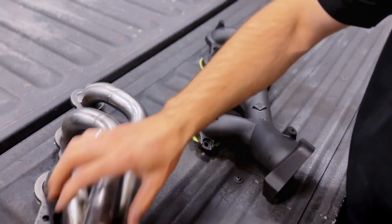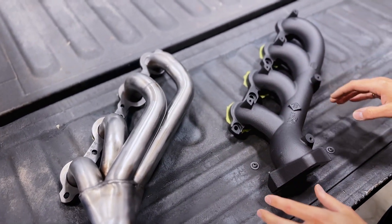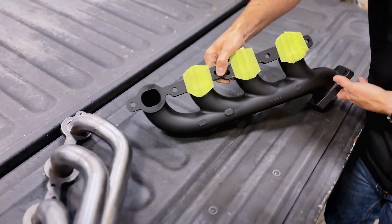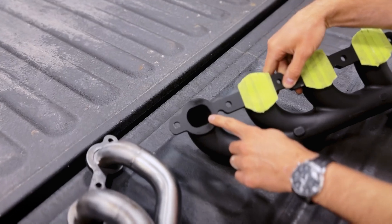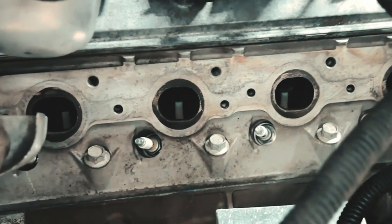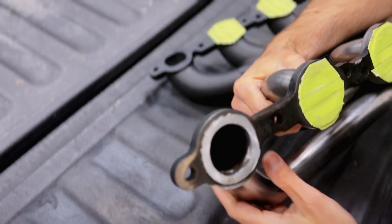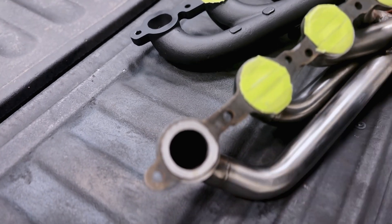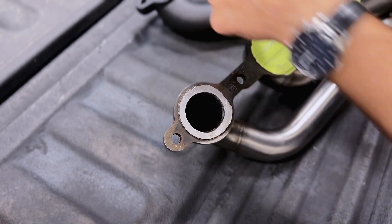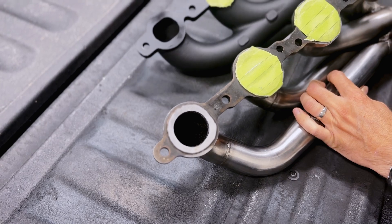The other thing to consider is that with each one of these joints, you end up with a transition for the air that isn't necessarily as nice as if you were to flow it smoothly. What we've done here — excuse my tape job, I've taped them off because we're going to hit the flow bench in a second — is you can see when we cast something, we can actually cast the manifold port shape to better match the cylinder head, to have that transition be as smooth as possible from the cylinder head into the manifold for the best flow. Whereas with tubular manifolds, you'll end up with just a big round hole. That's great when you build a race car with aftermarket cylinder heads and huge exhaust runners, but when we're just slapping this onto a stock cylinder head which has more of a small oval hole, that big hole isn't actually super great for flow. That big transition isn't as wonderful.